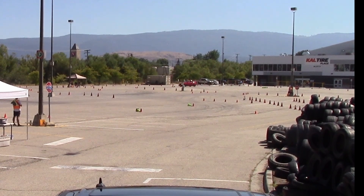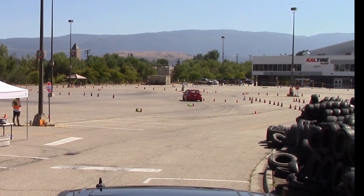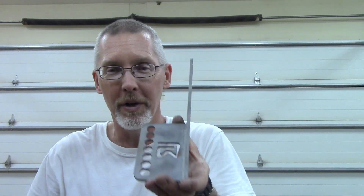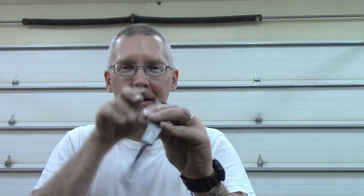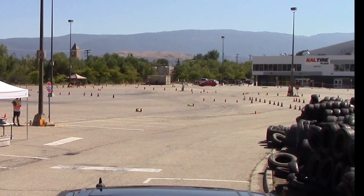I may get under there and measure it, jacking up one side and seeing if there's some twist in these arms. So before I run out and make a bigger diameter bar, I'm going to make another bar — plasma cut another set of ends and use 3/4 inch schedule 40 pipe for a bar and 3/4 inch schedule 40 for an arm. Because that arm, going this way, it's going to be a lot more rigid torsionally than a flat piece of metal.